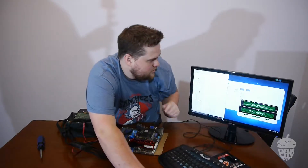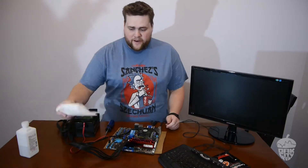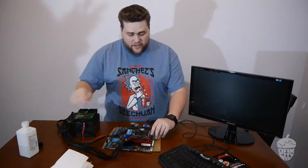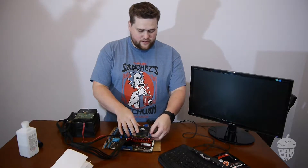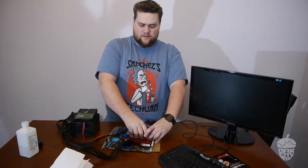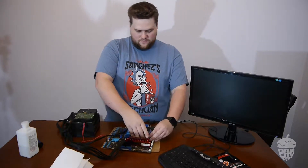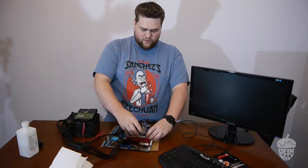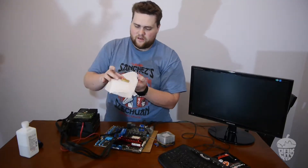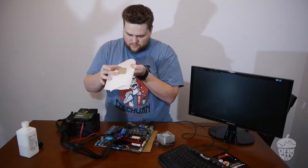Let me power off. This is my first attempt doing liquid metal and I have a pretty good feeling it's gonna go really well. Don't need a screwdriver for this because it's an older heat sink with just this retention clamp. This is one of the reasons I hate pin-on ZIF style processors — you typically end up having the processor glued to the heat sink and then you can't... you end up pulling the processor out of the socket. Oh look at that — came out with the heat sink. We'll clean the thermal paste off. I didn't bend pins, did I? No, we look good.